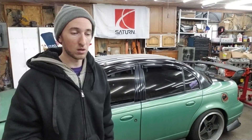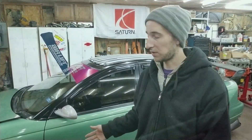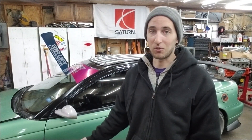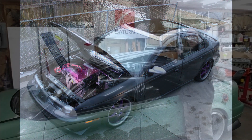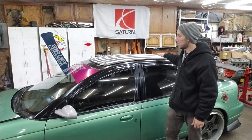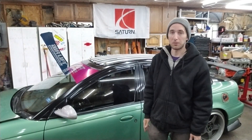Eventually I'd like to paint the whole interior gloss white to give it that car-in-white appearance and put some nice seats in it with a harness bar — I think that's in the future for this car. The wheels are XXR 962s, 17x9 with a 35 offset, running a 205-40 tire. I'd rather not have a stretch, but I can't get fitment like this without it. The car is on factory alignment — no unnecessary camber; it's not some super crazy stanced-out thing. The roof does come off. It's fastened with 15 neodymium magnets around the sides and back, pulling down about 150 pounds of force so it doesn't come up or rattle while driving. I also have hood pins up front for a mechanical bond, so even if the back or sides decide to lift, it's not leaving the vehicle.